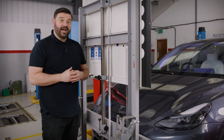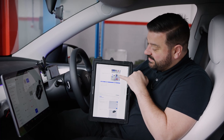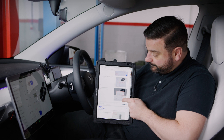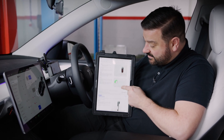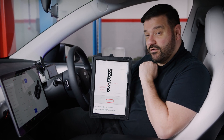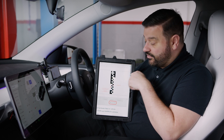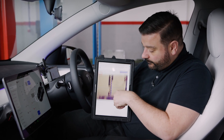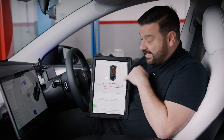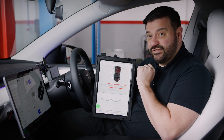With the ADAS equipment set up, let's head into the vehicle touchscreen and check the pitch. We enter service mode and go all the way through into the driver assistance system. What we're looking for is the line on the screen being in line with the top of the first box on the left-hand side, within the displayed tolerance. If it's outside that tolerance, the technical note tells us to reset the DAS system, clear any current calibrations, make adjustments and then continue the calibration.